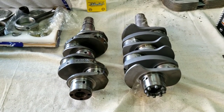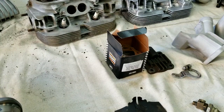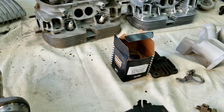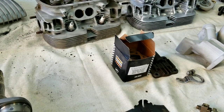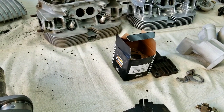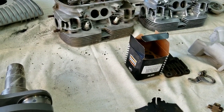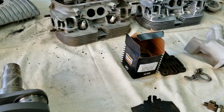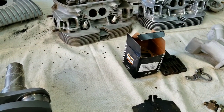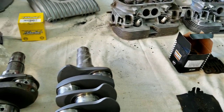Also, we're going with an upgraded oil pump — the oil pump is high volume, not only for the engine but for the oil cooler system and the oil filter. It's going to have to run a lot more oil through the engine and all the piping, so you really need a high volume oil pump. We're going with a 26 millimeter oil pump, and that's the kind of thing you need for your bulletproof build.